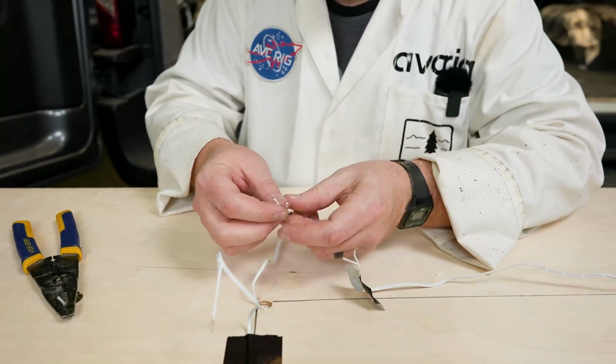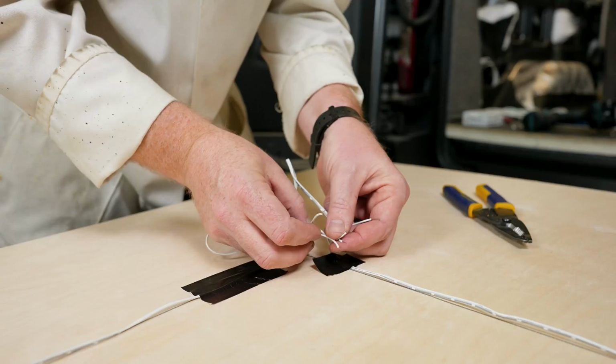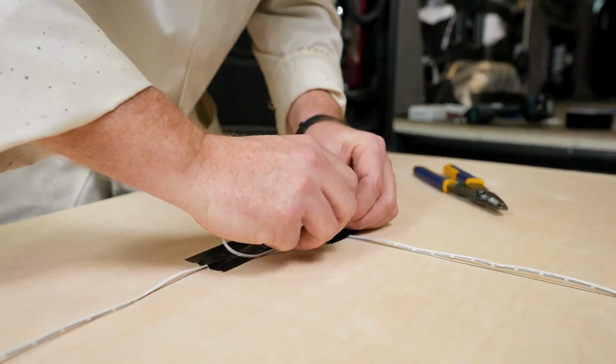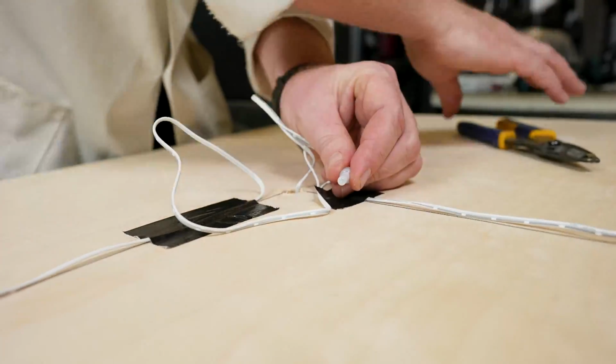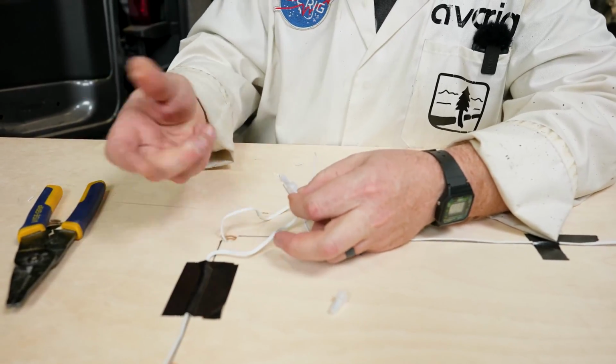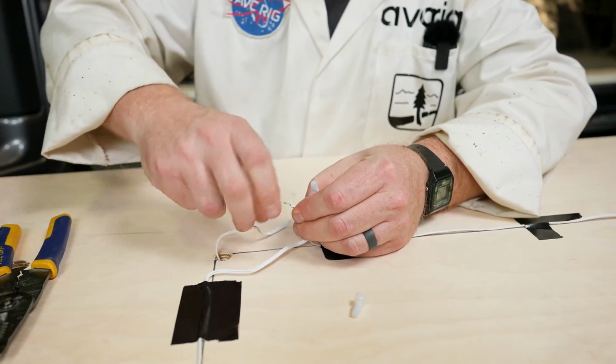So now we can just take our wires and we're going to put like to like. And today it's going to be extra difficult because I'm doing 2 different styles of light and the wires are backwards. And we'll put a crimp on that. And of course, we'll give it a pull test to make sure our crimp is successful. Do it again.